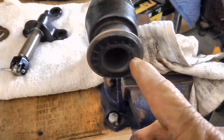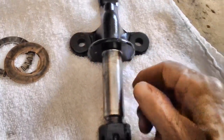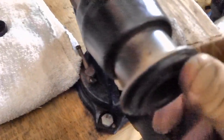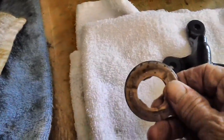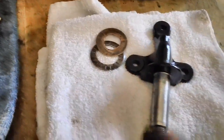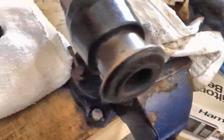That leaves us with this problem here. This bushing is in pretty good shape, especially on the top up here — looks real good there. It looks pretty good, but it is flattened out pretty far. Once I slide this idler arm bracket mounting rod down through there, there's a torque spec for torquing this up. We'll just have to see what happens. I may have to take it in to where I used to work — I think they have a hydraulic press in there. Maybe we can get it out with that, just press it on down through.